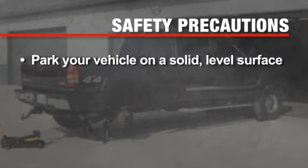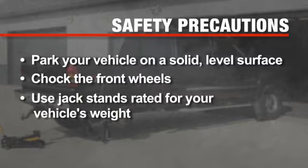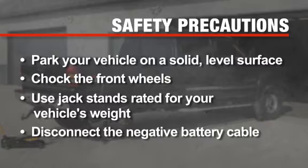Park your vehicle on a solid, level surface and chock the front wheels. Use jack stands rated for your vehicle's weight and disconnect the negative battery cable before any work is started.